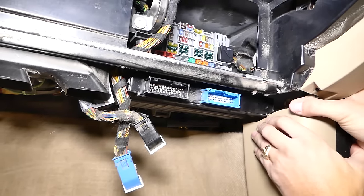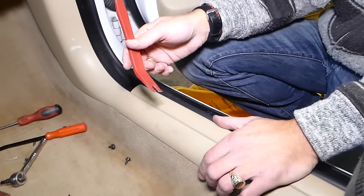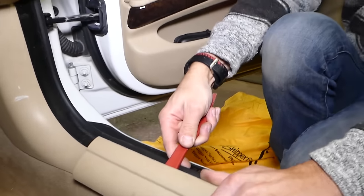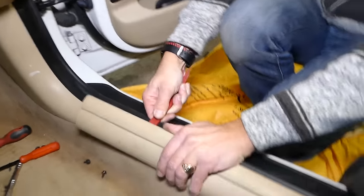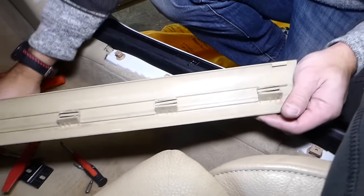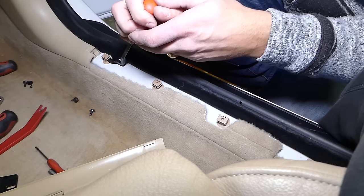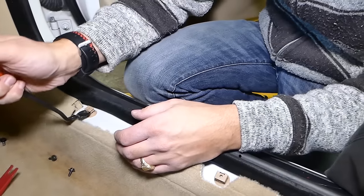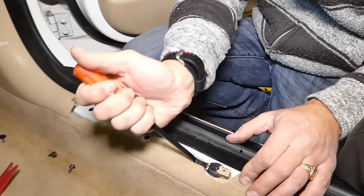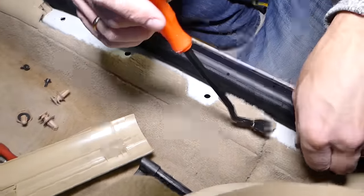The BCM module may still be catching on the side panel a little bit, so with plastic panel removal tools, pull that piece out — all the clips will come off. There is no other way to pull it out; you have to have the clip removal tool, which will be listed in the description. You can see all the clips — one, two, three, four — they need to be positioned correctly for reinstallation. Pull them out carefully one by one.